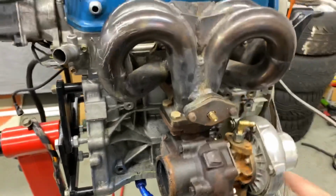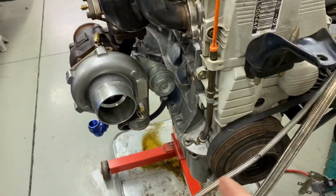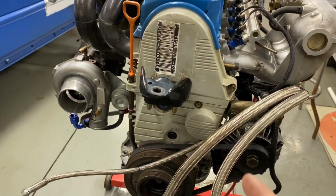So we had an EGT sensor, it quit working, so we clipped it off and are just using it as a plug right now because it's internally gated, so we don't need a wastegate there. I did add a boost controller for this on the car, so we should be able to tune our boost a little better and get more response out of this thing. Not going for more power with that, just better control.